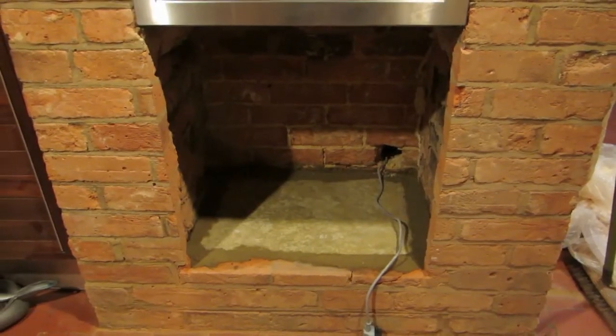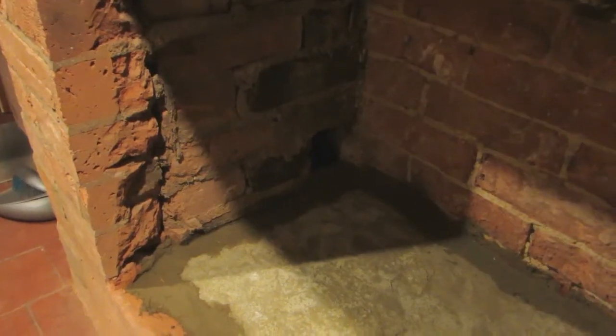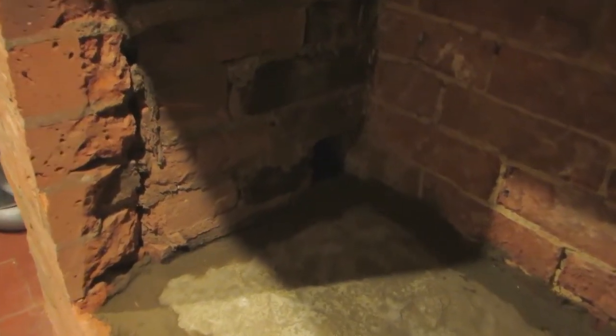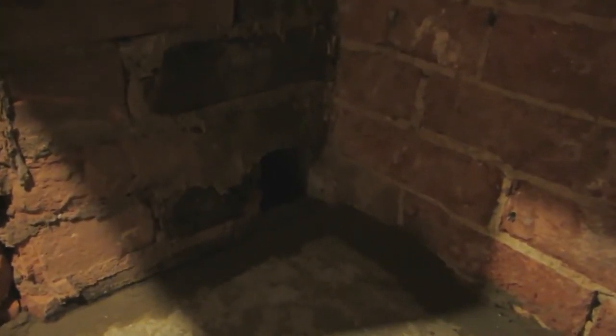And this is Neff's Aqua Stop valve to help ensure that the dishwasher's water enters the dishwasher correctly. A hole at the back had to be made large enough for the mains lead, as I had heard if the plug was cut off it could invalidate the warranty. This opening on the left accommodates the waste and water supplies.